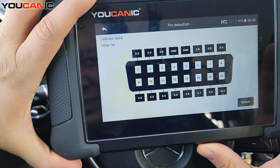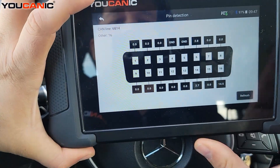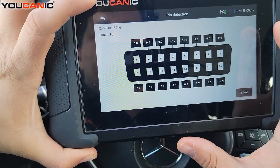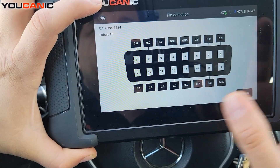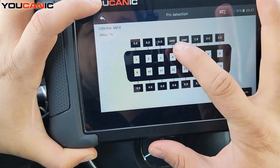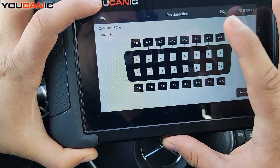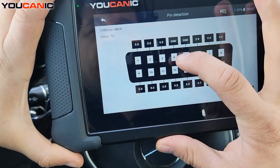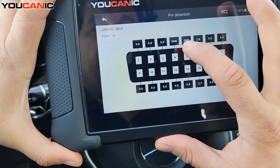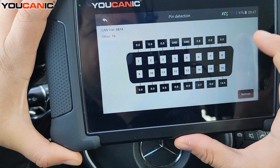What's important to realize is that your OBD2 port has all these pins, but they're not all connected — on the back of the car, they don't all have wires going through them. There are a few different protocols that different makes use to communicate. What's important is the ground lines. You have two grounds: pins 4 and 5 are grounds. That's pretty common across everything. You can use a multimeter to verify those and make sure they are connected to ground. If those two wires are damaged, you're going to get no communication with the car.